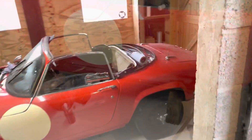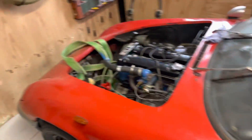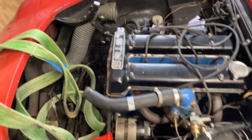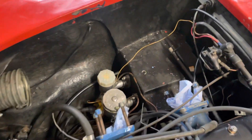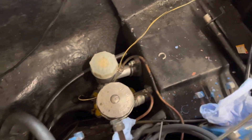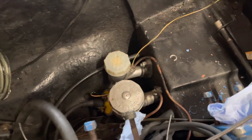I realize I forgot to do the clicky finger link thing. Anyway, this is where we got to today — all chassis bolts have been found and loosened, apart from those two behind the dash which I'll come back and do another day. Radiator is out, bonnet's gone, heater hoses disconnected, carbs and the joining manifold bits are off. Unfortunately, being a Stromberg engine, this manifold is cast into the head, so no swapping for Webers. These studs have got to come out so the body can come off as well, but yeah — brakes and whatnot still to do. Getting there — reasonable day's progress.